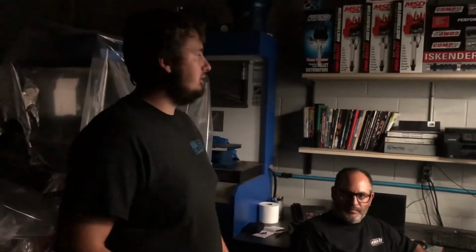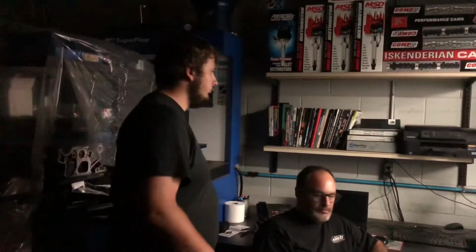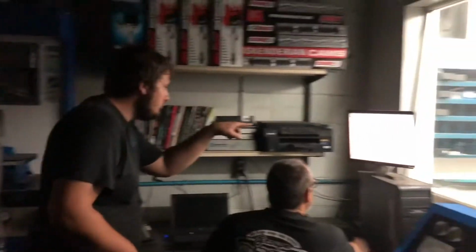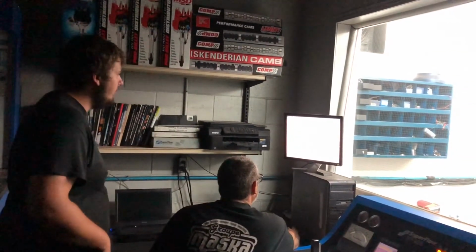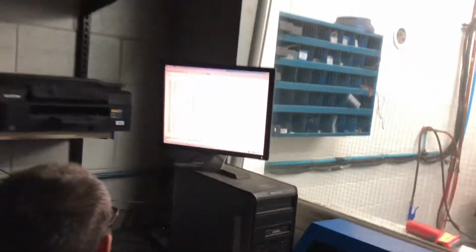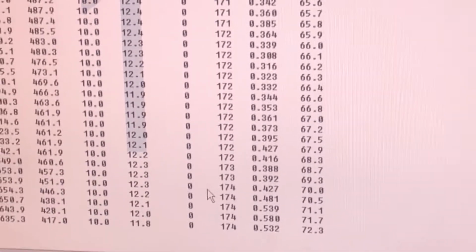Plenty safe, not going to hurt itself. Okay. You could tell 7,800 is definitely the horsepower peak, because the BSFC jumps way up. It goes either 7,600 or 7,700. That would tell me it's not actually using that much gas to make each horsepower. It's a pretty efficient engine in that turn.